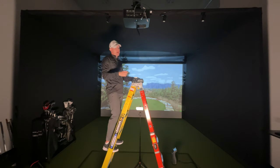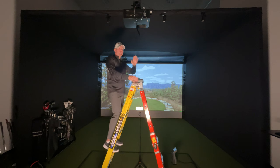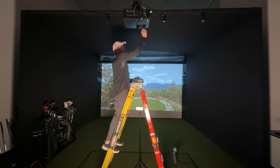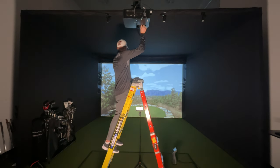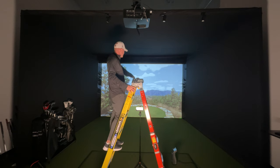If you can only get the image so far, you have to angle the projector to cover the screen, then use the keystone functionality to correct it from a trapezoid shape into a flat rectangular image. I've got it to where it pretty much fills my screen. I have some baffles up top from Carl's Place to help with wedge shots.